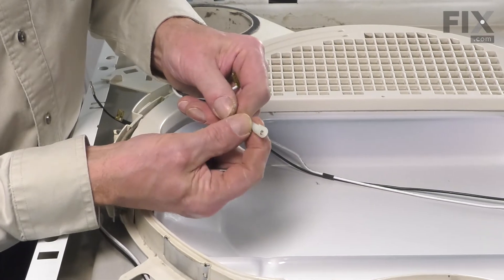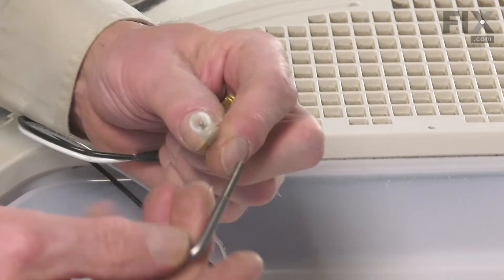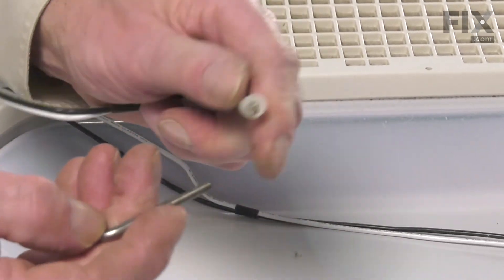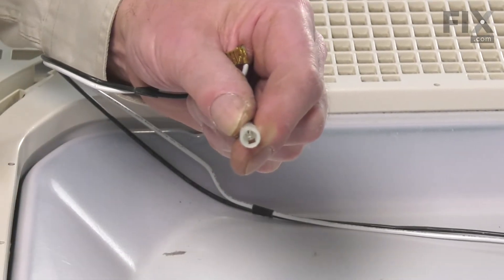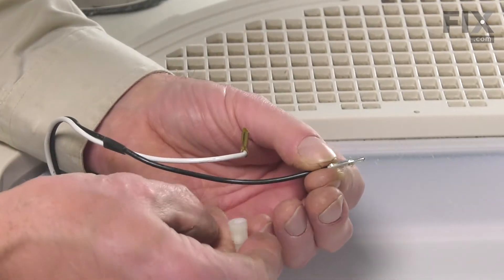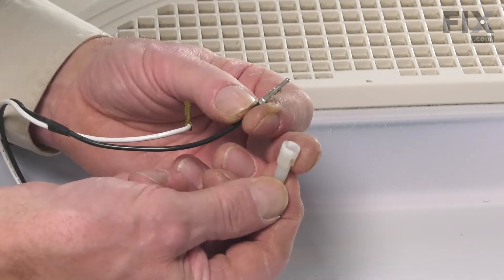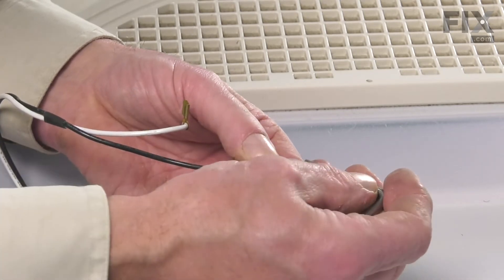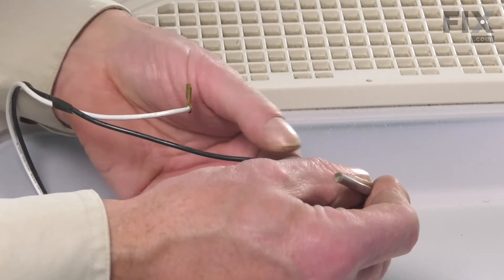We basically need to remove that plastic piece from that old harness. If you're fortunate enough to have a tool that you can slide over that terminal, that will collapse the two arrowhead supports that hold that wire connector inside of the housing. If not, take a small jeweler's screwdriver, go down through that opening, and just bend back those two tabs. That's the shape of that wire terminal — it fits up through the hole in the bottom of the housing and then locks in place on that collar. Essentially, what this tool does is flatten out those two tabs and allows us to pull that plastic housing right over the top of it.